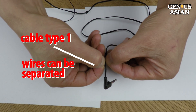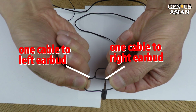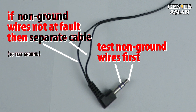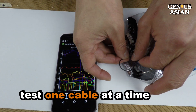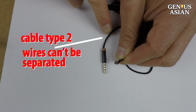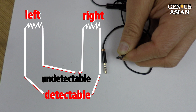There are two different kinds of cables. First, wires that can be separated: stereo earbuds usually have one cable to each earbud, each with two wires inside, one of which is a grounding wire. Test the non-grounding wires first; if they are not at fault, separate them. Tuck one cable of two wires inside the shield bag and testing is the same as for just two wires. Second, wires that cannot be separated at the base — then you may be out of luck and can detect only two out of four wires. If only one of the two ground wires is broken, that broken ground wire is undetectable because the two ground wires are soldered together at the sleeve.